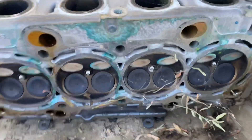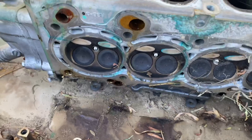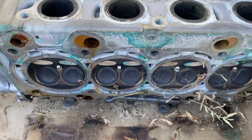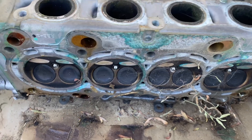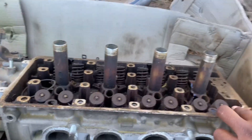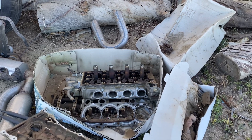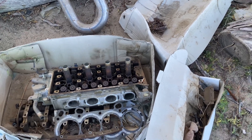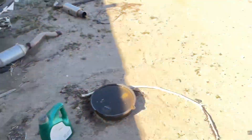They actually pretty much are the Z3 head realistically. If you see the valves on the K24, they're actually the same size as the exhaust — that's how you know they come with the smaller valves, because it's pretty much the non-VTEC head, even though the TSX does come with true VTEC. The RBB1 and RBB2 don't have these size valves. So that's basically the true K20/K24 myth — some people are saying that the TSX heads from '06 to '08 are not the same, but they pretty much are. I think just the springs on the intake side might be S2000 springs.